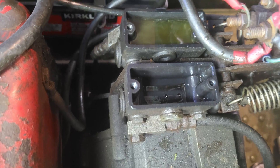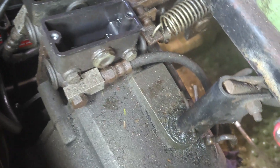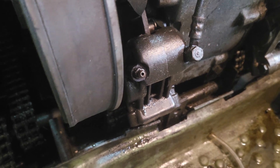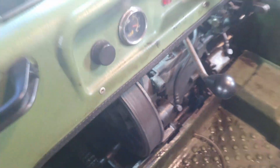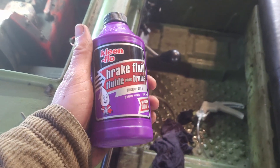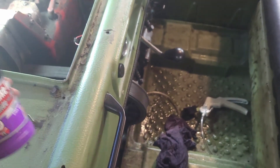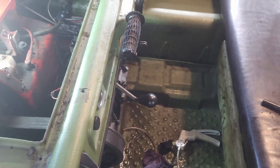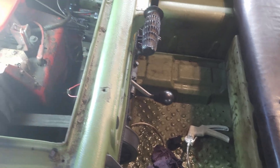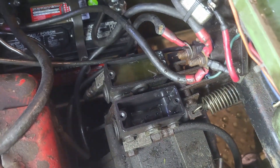There's our master cylinder — you can see it's all emptied and filled with DOT 3 brake fluid, which means it has gone through that line and into the brake caliper and flushed all the old gunky fluid out completely. Now all that's left is to put in the DOT 5 to replace the DOT 3, and that should be this side done. When I was showing the pumping, you're seeing what looks like air bubbles — that's just because it's easier to film it that way. When the camera's off I'm pumping normally, and we'll make sure there are no air bubbles when we're all done.